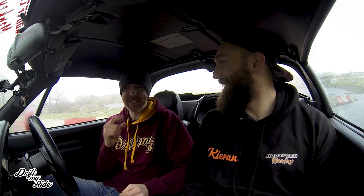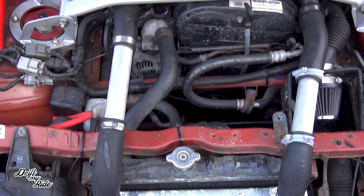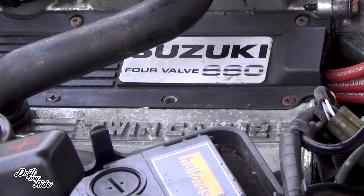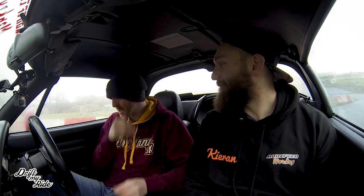We've got a 657, yeah, and it's turbocharged as well. What have you done to the engine? The engine has had bigger injectors, a new ECU, custom-made intercooler, boost control, and I've got my boost gauge fitted. I've had a short shift kit and boost control from the dashboard — easy access. What boost do you run? It's run at 14 psi, 1.1 bar. Has it been dyno'd? Yeah, it's been dyno'd and re-mapped. The standard was 63 and it's now 85 horsepower. It's a big jump percentage-wise.